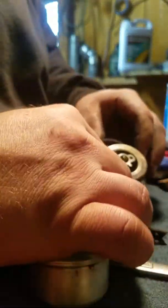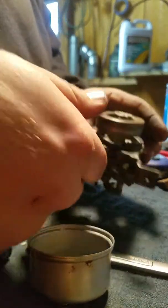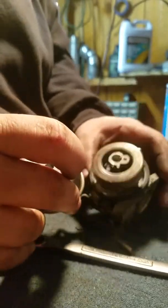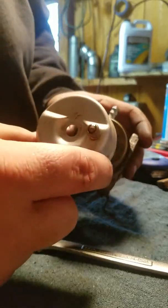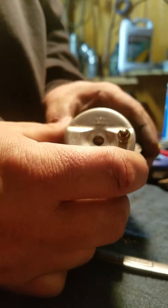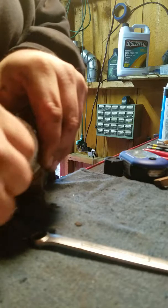So that's how to clean this carburetor. Put the gasket back on for the bowl. Like I was saying, the bowl here has to go on a certain way. The flat spot right here — and right here is the float pin — it needs to line up here so that the float travels into the deepest part of the bowl. Get that as straight as you can by eye, the best you can — it doesn't have to be pitch perfect. Go ahead and slap the main jet back in the bottom. Tighten it down.